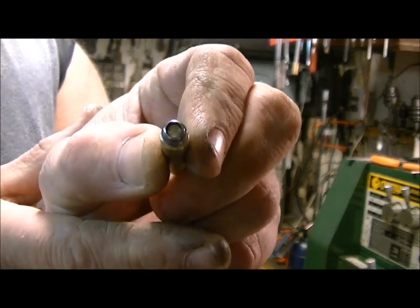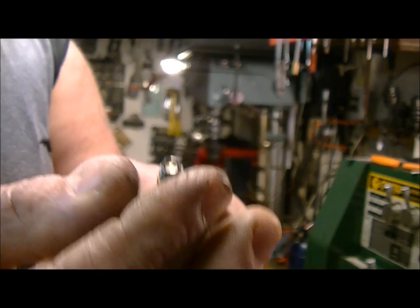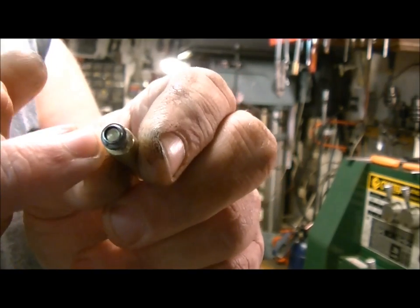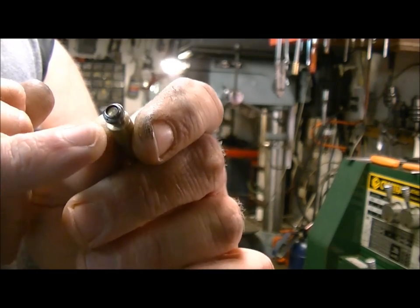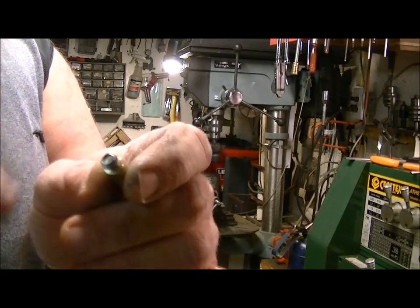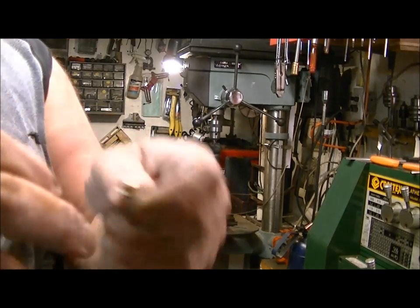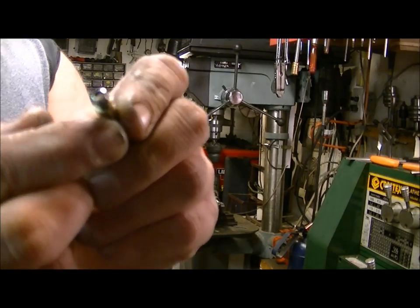As you can see, we've got a nice shiny transfer port now. All the edges are good and we've done the sides too. You'll notice that my tool is actually recessed inside — because of the length of the transfer port, you have to let it stick out so you can actually get at that inner area of the transfer port with the buffing wheel. Make sure that when you make the length on your tool, you accommodate for that, otherwise it's kind of useless.